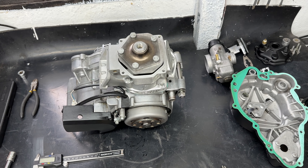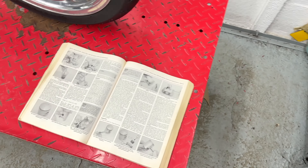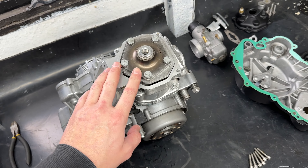With my T-piece of solder ready to go, it was carefully placed into the cylinder. You do need to torque everything up as if the bike is in a finished state — so it's 30 Newton meters in a cross pattern on the cylinder head.